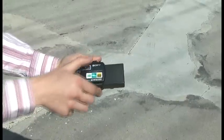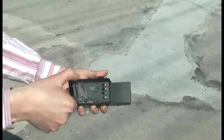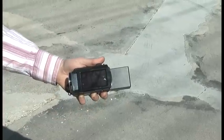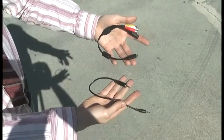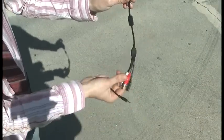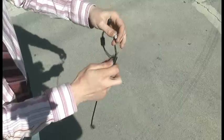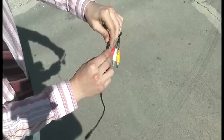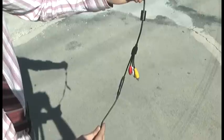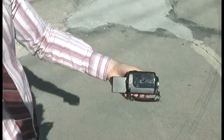To allow for your camera to stay on while filming, you will need to open the LCD on the side of the camera, flip it forward, and then push it back to close. Then take your two remaining Sony cable kit cords, your D cable and your LANC pigtail, and take the black open stereo jack, 2.5 in size, and plug in the LANC pigtail to the D cable. This allows for remote control signal to be sent from the camera to the controller below.